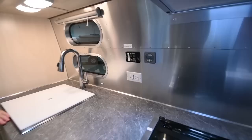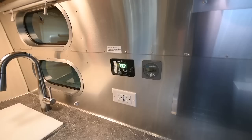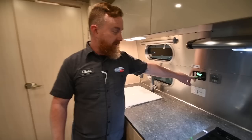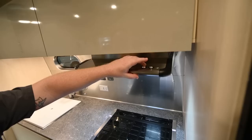In the galley, we're going to find the solar monitor panel. This trailer has a 90-watt solar panel. The solar system is automatic — as long as there's sun on the panel, it's already charging your batteries. You do not need to turn the solar system on or off, but this panel lets you monitor the status. Next to that is the inverter control — press the button on the right-hand side to turn it on. The inverter provides alternating current service when you're boondocking and all you have is the DC stored in the batteries. This is a 1,000-watt inverter with enough power for the television and DVD player, and you'll also find power at the plug below the dinette. You can cycle through to see battery voltage, shore power, and the draw. Turning it off requires pressing the button until you see the display flash.